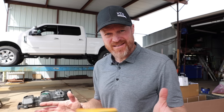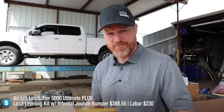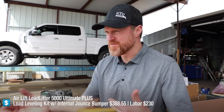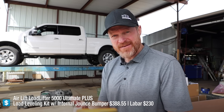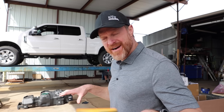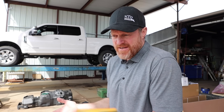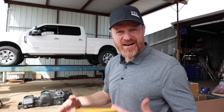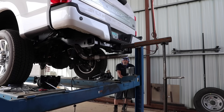Airbags are going in now. One of the reasons I went with air is because I wanted an onboard compressor anyway — just to fill trailer tires and operate the air horn. As long as I'm going to have an onboard compressor and a tank, I thought I might as well have the air bags. It does make the ride a bit softer when you're on air versus the leaf springs under load, and it gives you the added benefit of leveling things out. The Airstream has such a light tongue weight that it wasn't critical, but as long as I'm going through all the effort and keeping this truck a long time, I figured might as well add the bags.